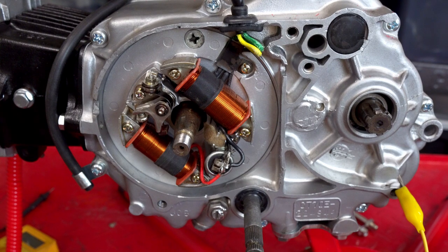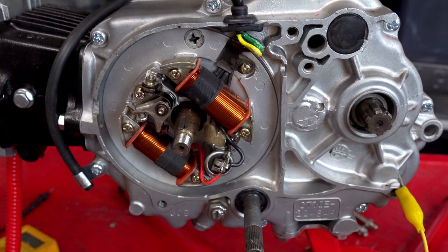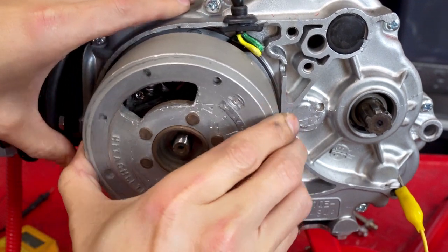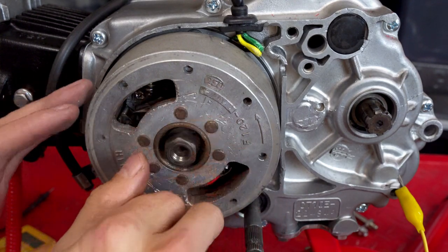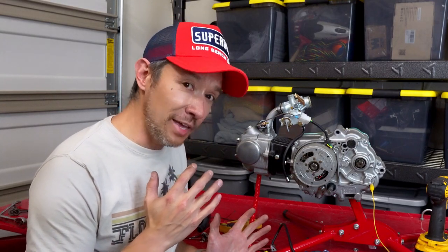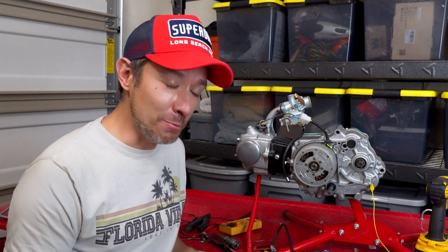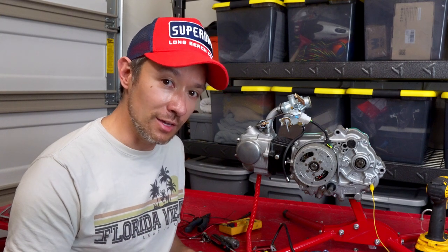Make sure when you're putting your points on that nothing's being grounded out — that the wire is on the right side of the insulator and that the tab isn't touching the frame of the engine. Once you have everything sorted out, take that key and slot it into the shaft first, then line up the flywheel with the key centered, then the washer and nut, and tighten that down. Anyway, I just wanted to put this together because it took way longer than it should have, and hopefully it's of help to some of you. Hopefully soon I'll have this engine started and on the bike — that CT70 is actually going together pretty quickly. Thank you everybody for watching, stay tuned for more videos and keep on building.